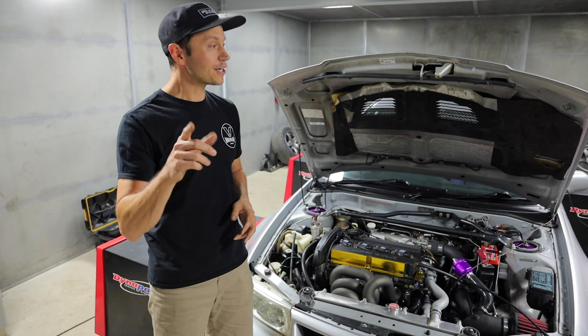We wanted to take a day to decompress with all that sad news and bring it back to the shop, just think about it a little bit more as to what happened. After a little bit of deliberation, we're still leaning very much towards the head gasket — it's pretty clear. After watching that video over and over again, I realized you can see the coolant coming out the side at the end. And the sparks coming out is, unfortunately, the combustion cycle being spit out the side. And that's not a good thing.